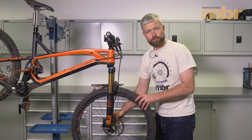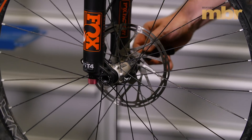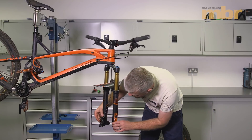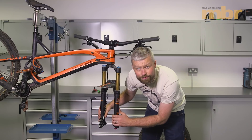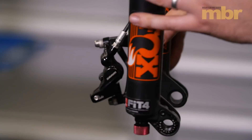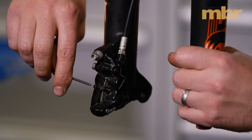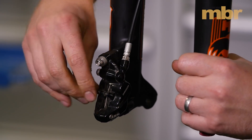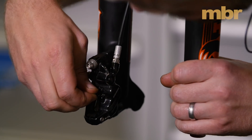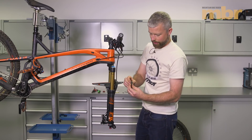First thing we need to do is remove the wheel from the brake that we're going to swap the pads on. On this SRAM brake — it's a Guide — it's very similar to most brakes out there. You've got a little clip which sits on the end of the pad retaining pin, and in this case you've got a 2.5mm Allen head on the pad pin. That spins out, and that enables you to remove the pads — they're top loading in this brake, so they just come straight out from the top.